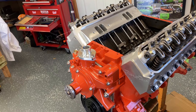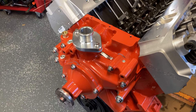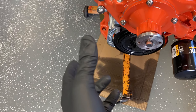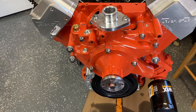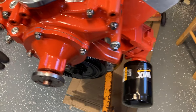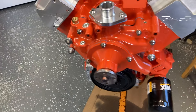So the engine looks a little bit different since last time. Simple things I didn't show on video: oil pump's bolted on, water pump's bolted on. You'll see I have some washers stacked here and a thin washer there, because that's made to hold an alternator bracket into place. I think he's going to use a serpentine kit, so I'm just leaving that as is. These bolts were too long and they're the fancy ARP ones. The top two are ARP; the other two are factory bolts I had to use — I don't think you'll ever see them.